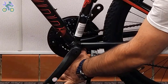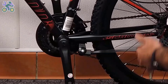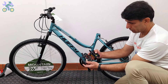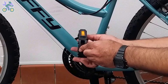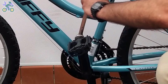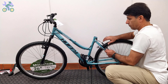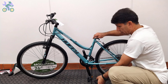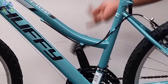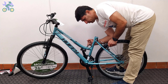If the chain has come off the sun wheel or sprocket, reinstall it by placing it on the sprocket with your thumb and turning the pedal once. Install the pedal by hand only, without touching the threads and without using tools. Be careful to install the pedal vertically on the crank arm to avoid damaging the pedal and crank threads. For the left side, turn it counter-clockwise — or an easy way to remember is to turn it toward the front of the bike. After making sure the pedal is in the correct position, turn it a few times by hand, then while holding the rear wheel use a 15mm wrench to tighten it.